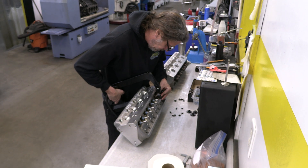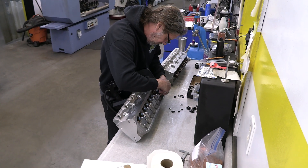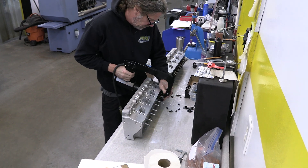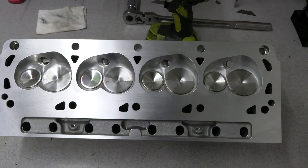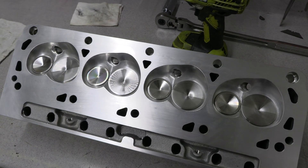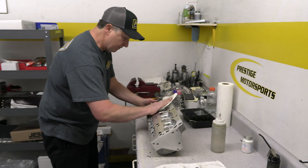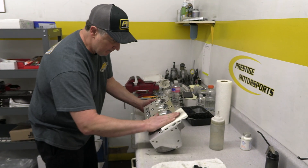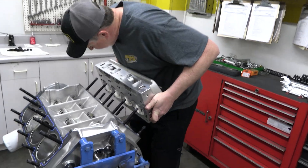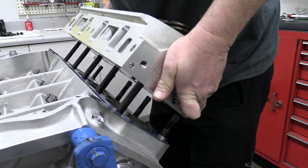Prestige has their own CNC machining, design, and cut capabilities, and these cylinder heads are one of their many custom products. This is a Brodix Track 1 casting that Prestige modifies to their own requirements. It has a 72cc combustion chamber and 220cc intake runners. The intake valves are sized at 2-inch 100-thousandths, while the exhausts are 1-inch 570. With the highly efficient 72cc chambers, the compression ratio comes out to 10.5 to 1.